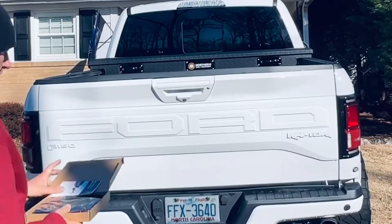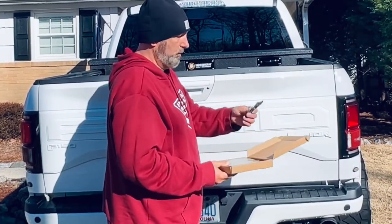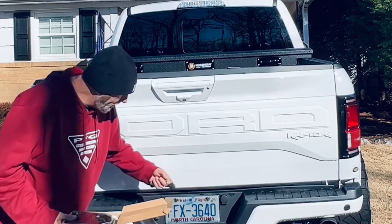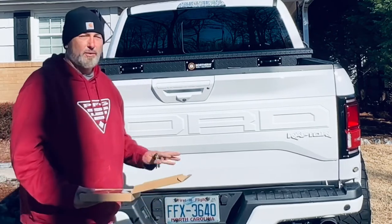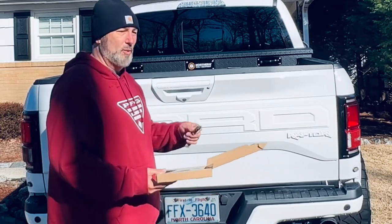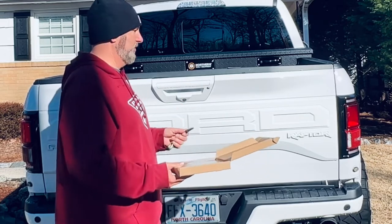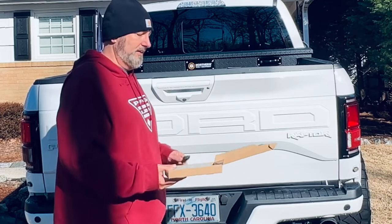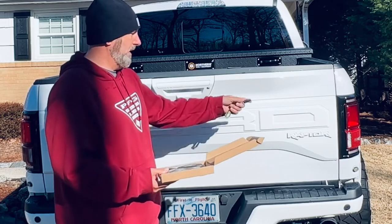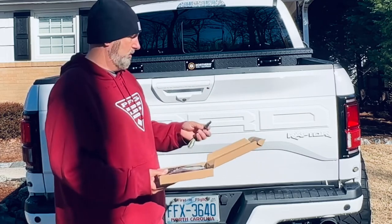You have your instructions in the box. They also give you a plug that you can plug into right here — the four-pin adapter. But we're not going to do that because on the Fords, it gives issues with the backup camera and the sensors. It thinks there's a trailer connected. So I'm actually going to cut those off and direct-connect them into the tail light, brake light, and turn signal wires.